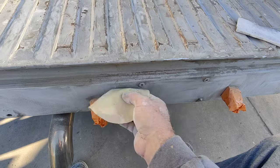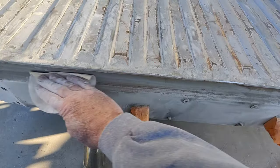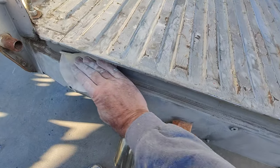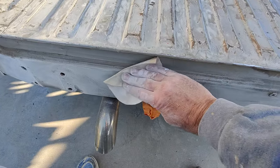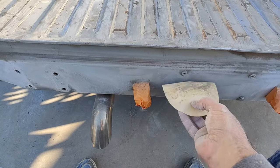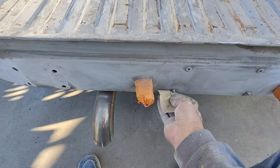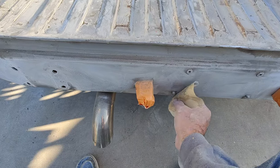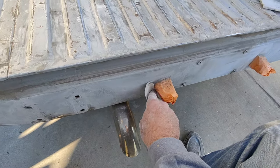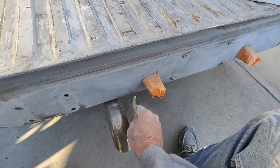The other thing you can do is use Intercoat Clear, but that stuff's expensive now too, over $100 a gallon. Another thing you can do is just take clear binder and add clear binder to your base coat. You can add a lot more clear binder in there. Clear binder is basically just clear base coat. It's kind of like that, but not exactly the same. It's a little bit of a cheaty method. Some people will say maybe it doesn't adhere as well or whatever. I don't know. I don't think there'll be any issues with that.